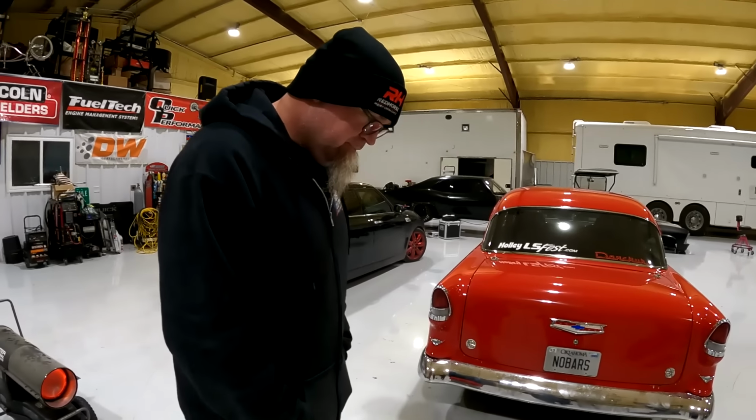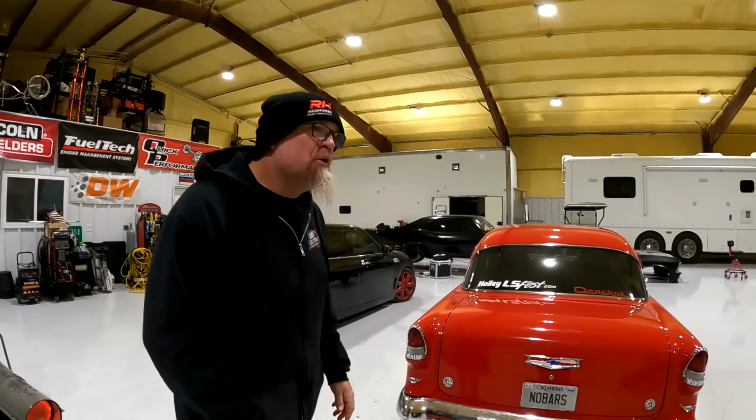You know why? I mean, there's probably several reasons. Well, that converter is loose as shit. 100%. Yeah. So it ETs way better. Miles per hour is close. Honestly, it probably makes pretty close to the same crank horsepower. Across the board, it probably actually makes more, and that's the reason you can have a looser converter and it will ET, let's just be honest, probably a little bit faster, at least than what ours did. Yeah. And that's the reason we like it to be loose out of the hole, because once it gets out there, we have the ability to not lock it up. Yeah. But it seems like it does. It comes close. It gets pretty close.